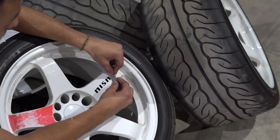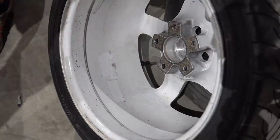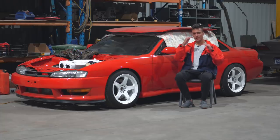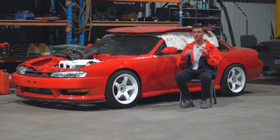For some, the original stickers might be a real painful thing and you don't want to do it — totally up to you. I didn't care so they came right off. Step number three: inspect and see how much curb rash there is and decide whether you want to give them a light refresh like I did or change the color. If there's curb rash, you're going to have to sand those really bad sections out, sand them down, and put body filler or some sort of metal filler there. Custom Spray Mods has a really good video on refurbishing wheels and curb rash, so go check that out if your wheels are really bad.